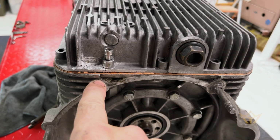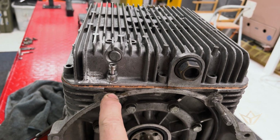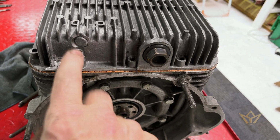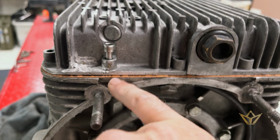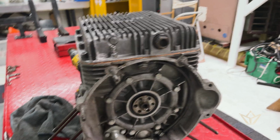Now I could helicoil this, but when I cleared it through, there was still quite a lot of travel down inside. Considering there's this many bolts around here, I've just screwed this down super tight, so certainly torque tight. So I'm going to cut this bolt down. It'll give me this distance shorter, and that should bed this problem out, so that'll solve that problem.